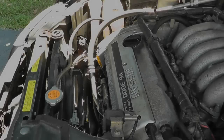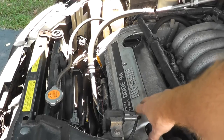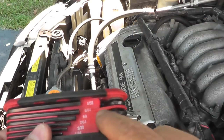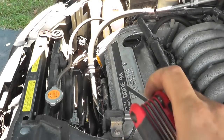That's how you get clear access to the back, or the left side of the motor — again, that's toward the firewall. Now for the front, or the right side of the motor, you have this cover. To remove this cover there are four Allen bolts, and the size of the Allen bolts is five thirty-seconds, so you need a five thirty-seconds Allen key to remove all four bolts.